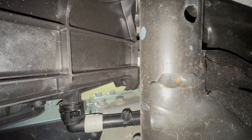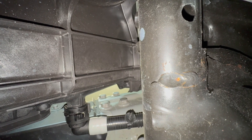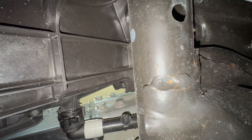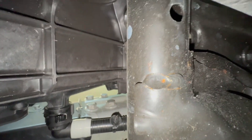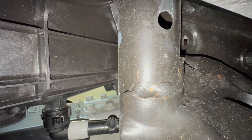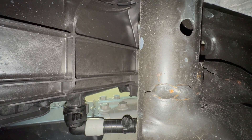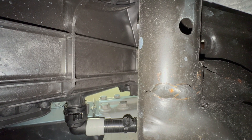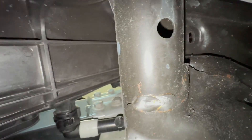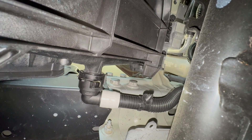I really don't know why it's leaking right there. You can see that they put a new connector on it, but it's still leaking right there — something is not right with that thing. It doesn't look like the thing is cracked or anything. It probably just doesn't have a seal inside of it, so I'm going to have to take it off and see if the o-ring that is supposed to be on that thing is still there. That's the only reason why it could be leaking — if the o-ring is not in it.